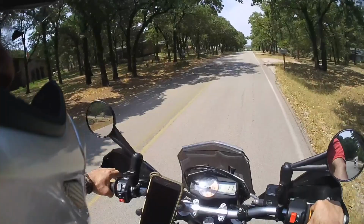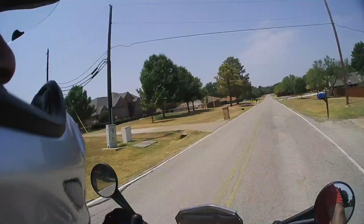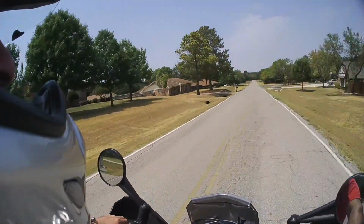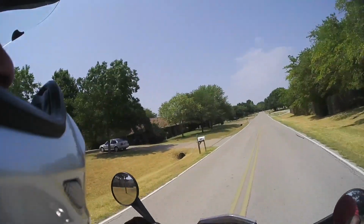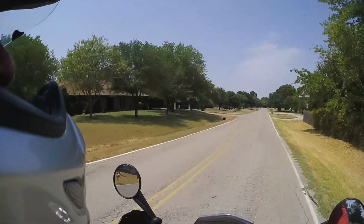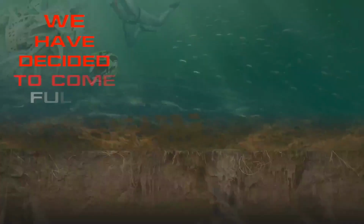She wanted the XT250, and that comes with a couple of sacrifices. She needed the clutch to be lighter. We first decided to put some slack in it, get it closer, which kind of sucked. So we did some research, and we decided to take some of the preload off of the clutch springs.